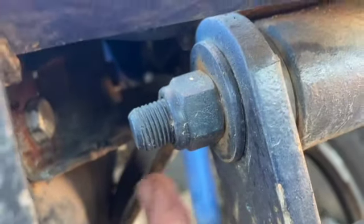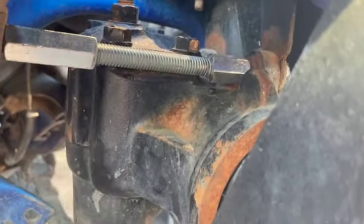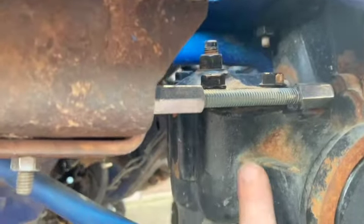The problem with the third generation is you have a massive engineering defect right here. You've got this behemoth, and it will constantly break this bracket. You can see this bracket's already broken in half. With this design, they put this flimsy quarter-inch plate bracket in here and it's nowhere near strong enough to support the torque that this thing puts out. So you have to brace this yourself — there's my sweet all-thread-with-coupler Robocop steering brace. You have to make a brace on your own or it's going to break your frame and your mounts.